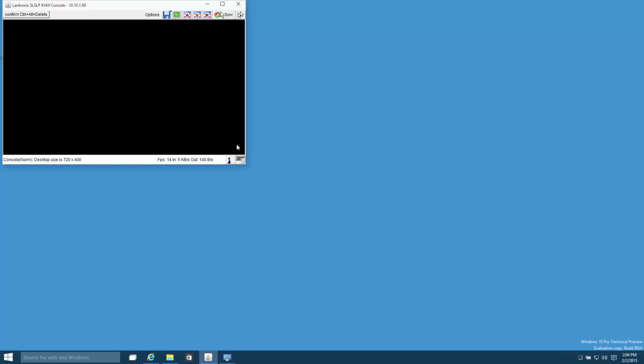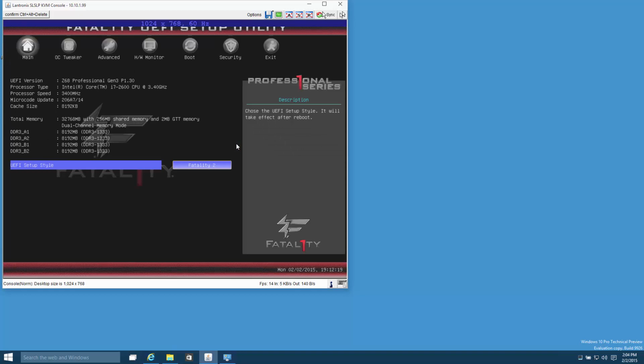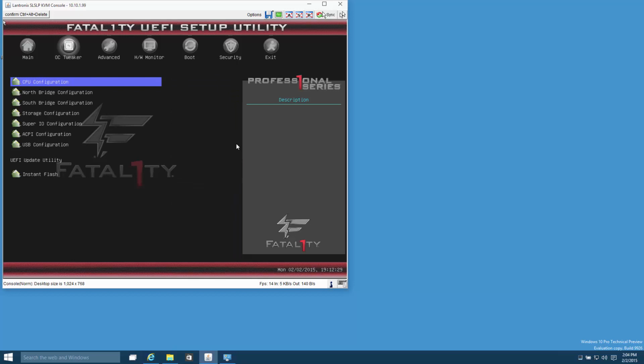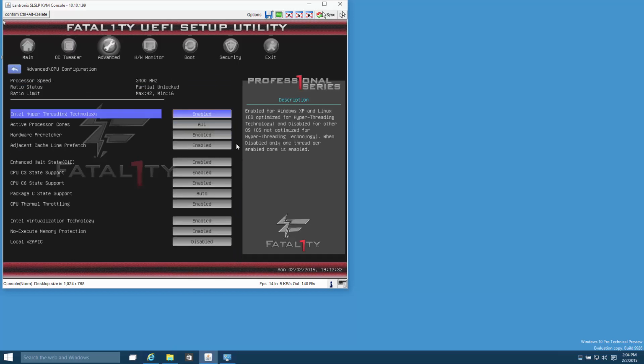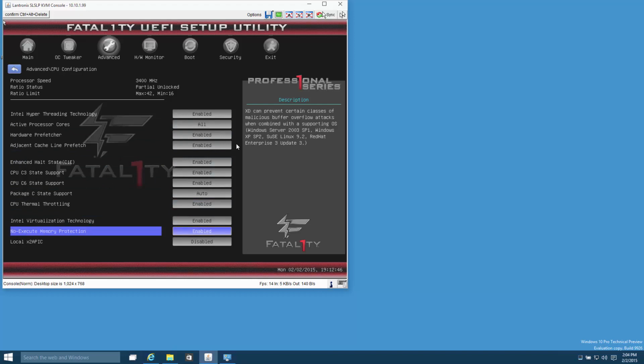I hit delete on this particular BIOS to get into the configuration. You may have UEFI BIOS or something different. That's okay. Some of the most basic settings are about the CPU. This video is not intended to be comprehensive and a look at how every computer can install VMware vSphere ESXi. It's really just meant to show the basics of getting going. But you'll want to make sure Intel virtualization technology is on and no execute memory protection. Those two pieces you want on.